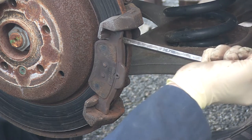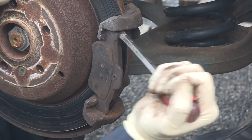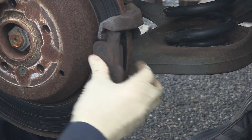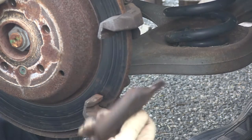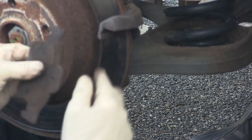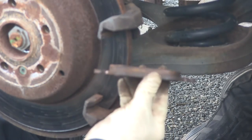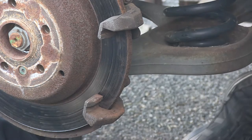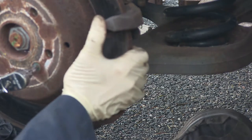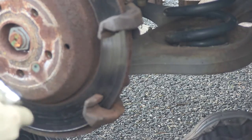So this person didn't — at the very least — they only had one brake pad stopping this wheel. We'll have to grind this down, clean up all that rust that was holding this in place. The pad itself doesn't look bad in terms of thickness. I loosened that — I might as well just take it right out. It just happens to be a T30 Torx bit.